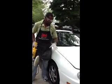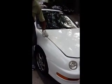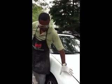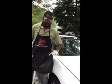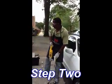Come in just a little bit close to Mr. Cameraman. Just take a look at it. Nice and smooth. You see the swirl marks we have there from the compound machine? This is why we have to use the machine glaze. Machine glaze is going to take that out and also just add a little bit more protection for the paint. All right, for the water, the sun is going to give it a little UV protection. Okay, so step two now.